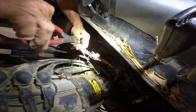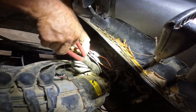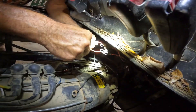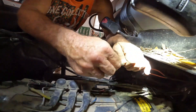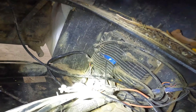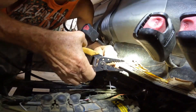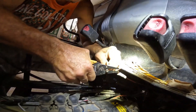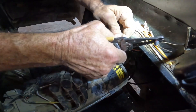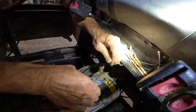Those two are the converter and one of them is the old battery monitor. Each of these has like a computer, a controller. It may seem a little complicated, but really all you've got to do is replace where your old negative and positive were and replace them basically the same exact way to the new lithium pack. It's actually pretty easy — you just replace the old black and the red leads with the new ones for the new battery pack. That really is all we ended up doing.